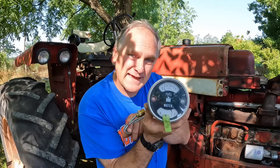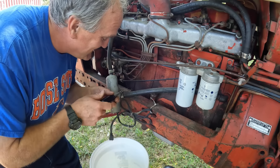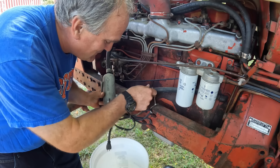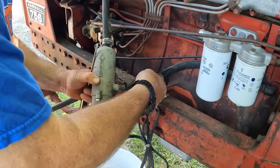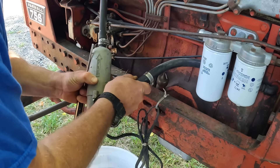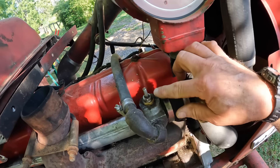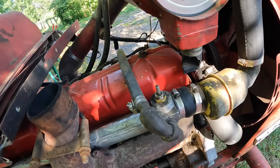He did a good job. I'm going to put it back in. It's not as easy as just plugging the new gauge in — the sensor dips into the coolant jacket in the head to measure temperature, so I have to drain some coolant off first. That's enough right there; we don't need to drain the whole thing. And this on the other side of the engine is where the sender goes. That's the bulb where the wire broke off.